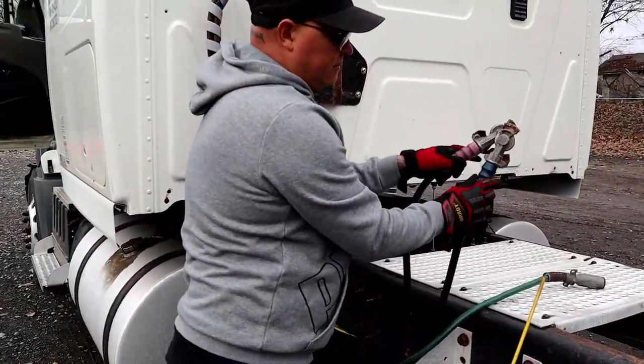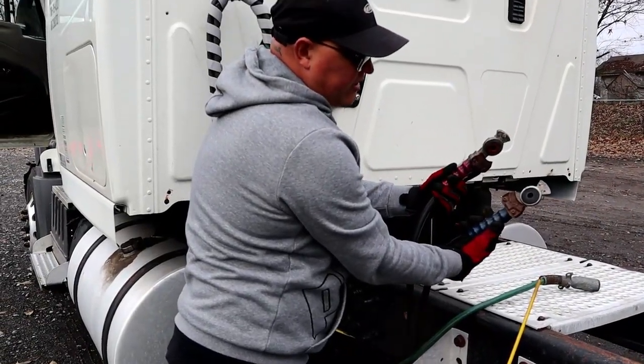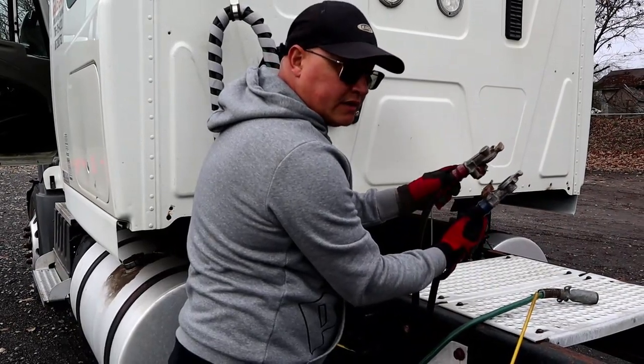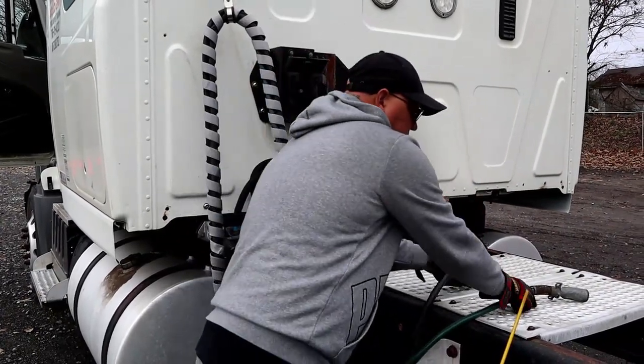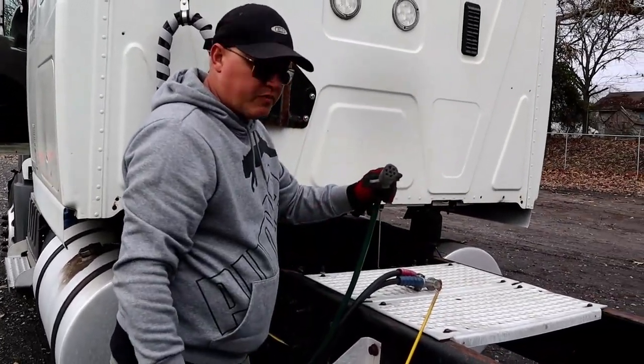That's the glad hand, and you have your grommets on the inside. The grommets should be properly secured — not bad, cracked, or broken, not cut, torn, or dry rotted — and you should hear no leaks. Our electrical line gets connected to the trailer, which should be properly mounted, secured, and locked in place.